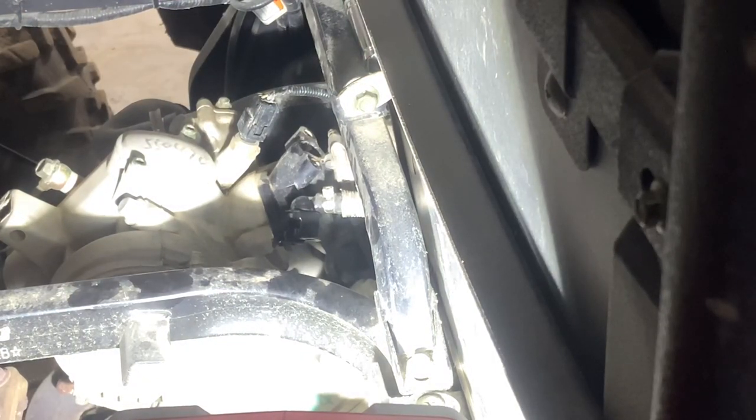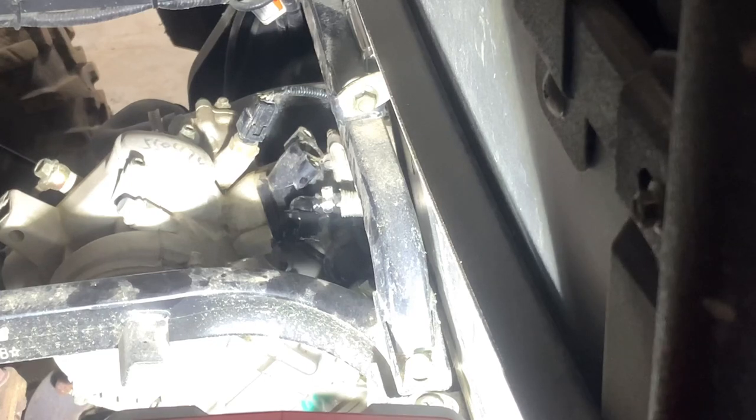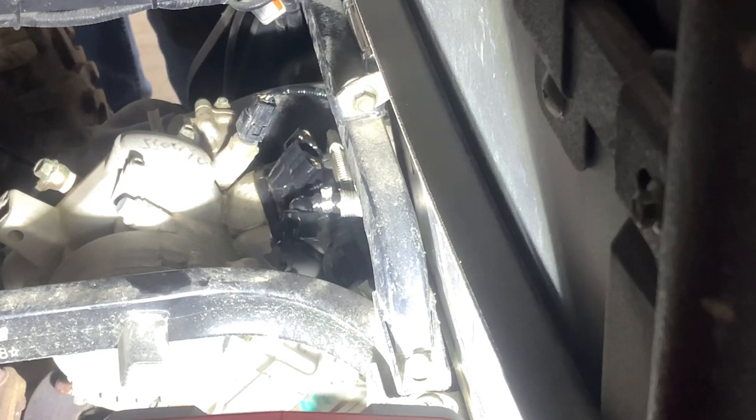I'm going to make a little bit more mess. I'm going to turn the key on and cycle some gas out of the line in case there was dirt behind it. You don't have to do it much. You've probably seen it went everywhere, but it's just a good thing to do to get that old gas out. I'm going to get some lube here, spray down in there, get that dirt out. Get that all washed down in there. I got the new one. By the looks of it, they look exactly the same. By looking at it now — I know you won't be able to see it on camera — that one hole looks clogged up. So hopefully that does it.